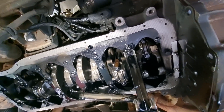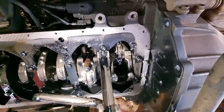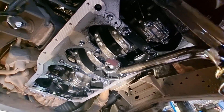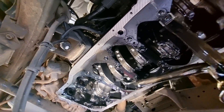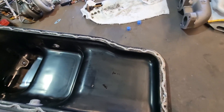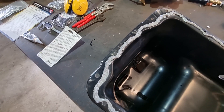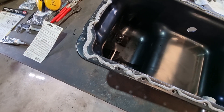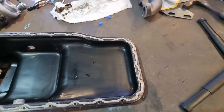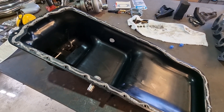Clean the bottom of your block up as best as you can. The hardest section by far is this rear section — just take your time. Razor blade, green scratch pad, be gentle, don't distort the surface. I put a little bit of extra sealant at the back of the sump — I don't want any leaks at all, especially not at the back there because it's hard to access. It's going to delicately go in place — have a few bolts ready in your pocket so you can sit it in place.